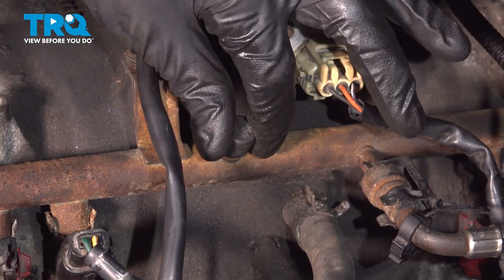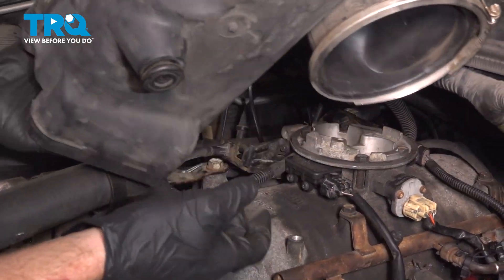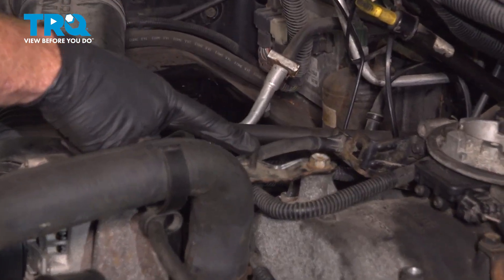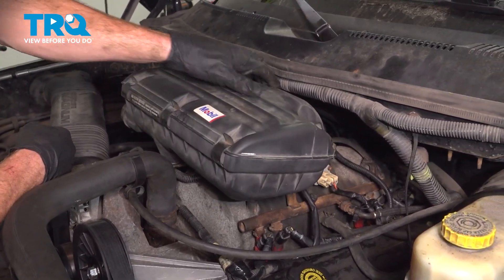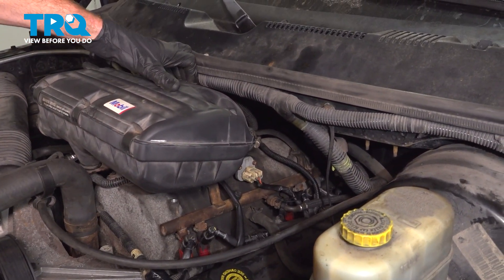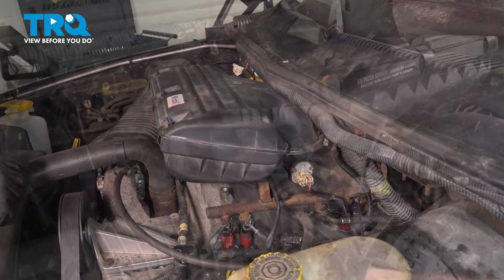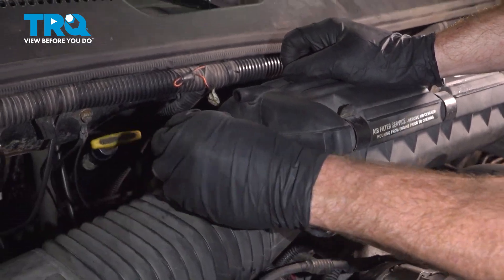Reinstall the cap on the fuel rail. Once you've done the fuel injectors on one side of the intake, go over and do the exact same thing on the other. Now we can install the air filter housing. This area will go over the throttle body. You also have a rubber bushing along the forward area that will go right along the alignment stud. Shake it around a little bit until it's completely bottomed out against the throttle body, then tighten that 8-millimeter-headed clamp. Install the air inlet hose and move along to the breather hose.